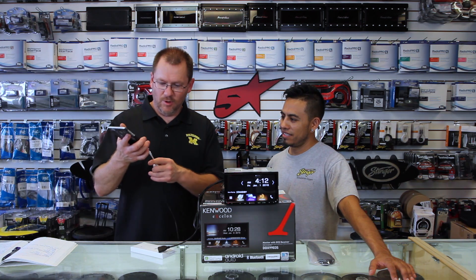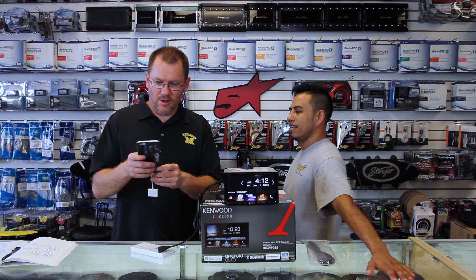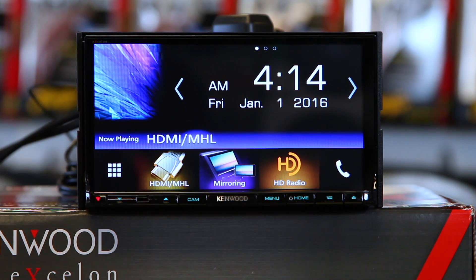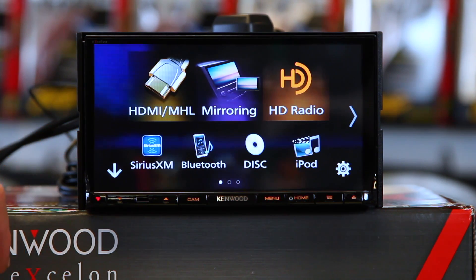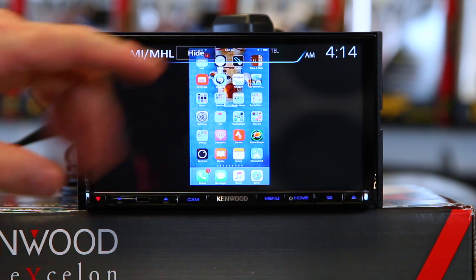So what do we want to do? Well, we just want to plug this bad boy in. Plug it in and unlock the phone. Now, let's take a look at the face of the radio. What you want to do is select the HDMI icon as a source. If yours isn't there because you've rearranged your three favorites, go ahead and tap to show all sources, then touch HDMI. Now you'll see your phone on screen.